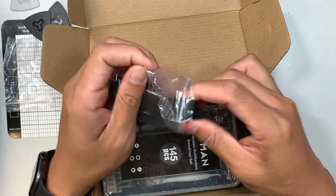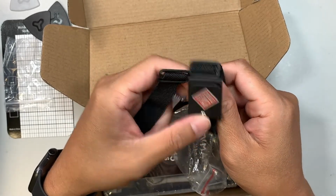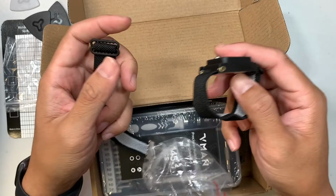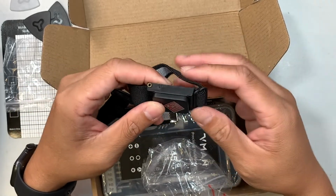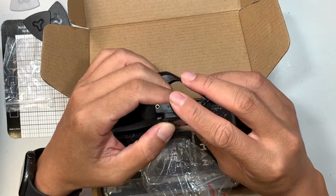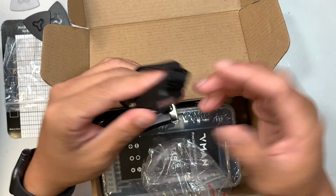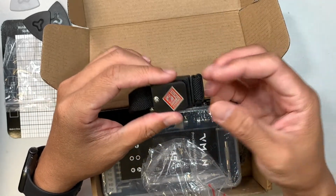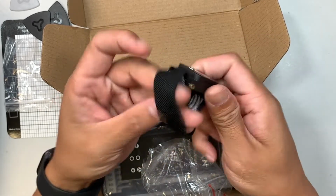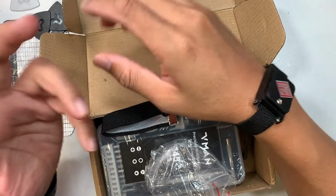And let's talk about what else is here. So they do have some strap, and I believe this strap here is the anti-static strap, meaning that when you work on laptops, you want to discharge any of the static that's built up in your body, right? Sometimes you walk on a carpet, especially in an AC environment. If you're in the office, definitely you get charged by dragging your feet or your shoes, or you wear some kind of jeans and whatnot, you scrub yourself, then you get an electric static charge on your fingers. So having this wristband here would help you discharge any of the static while you're working on electronic stuff. So it's a good tool to have, and I highly recommend you use it.